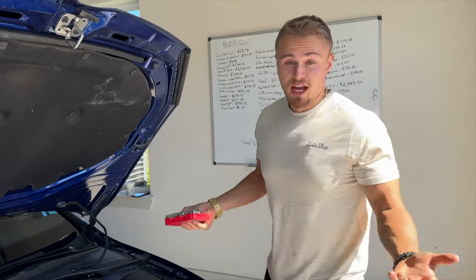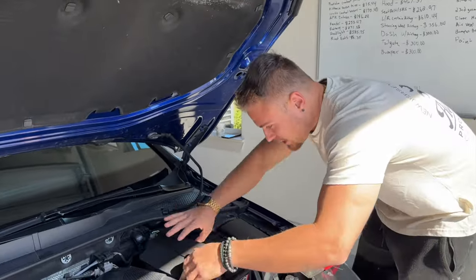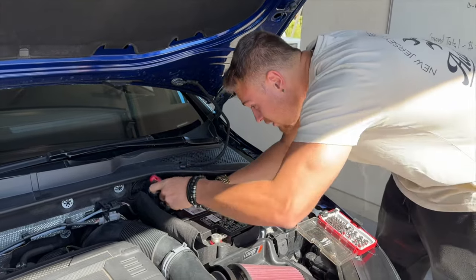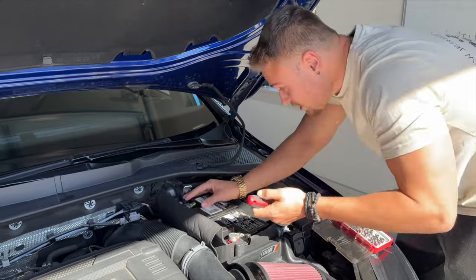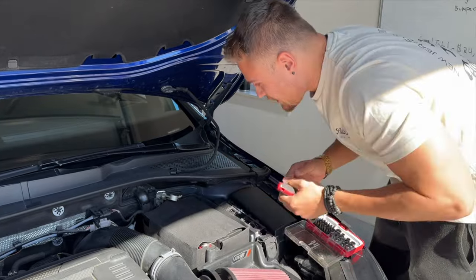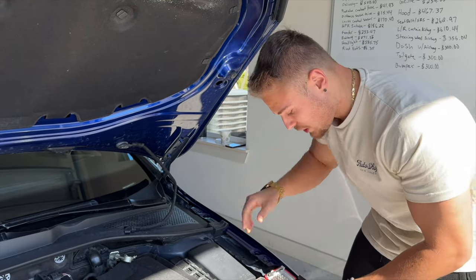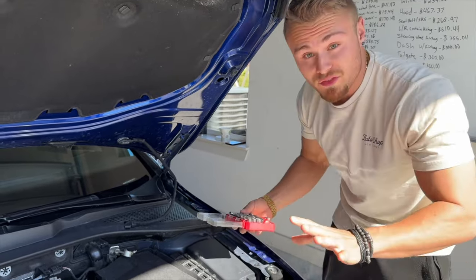You could use this as a guide for either cars. Now in order to undo the battery, pop this open. You just need to unplug the negative terminal — it's a 10 millimeter. We're just going to unscrew this, kill the power going to the battery before we touch the airbag, and let this sit for about 10 minutes. You want all the electricity that's built up to discharge and dissipate before you start tampering with any of the airbag or electrical systems.